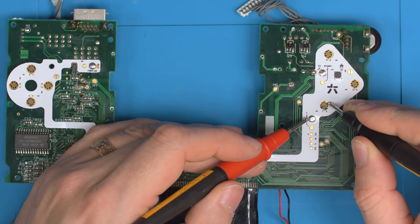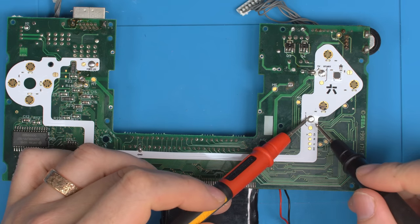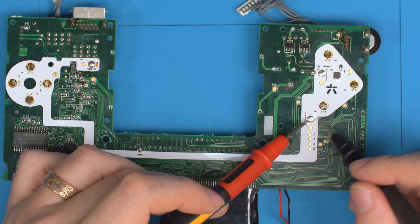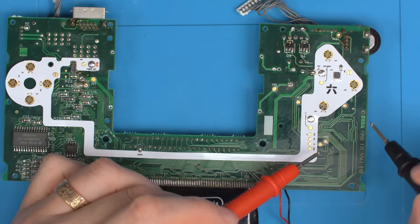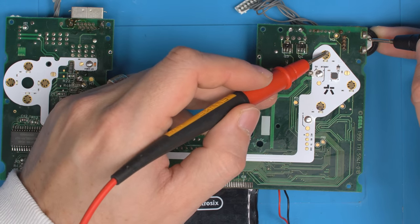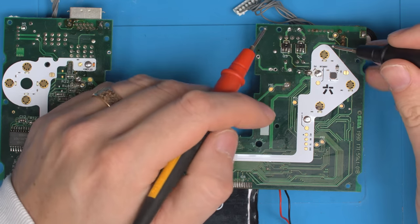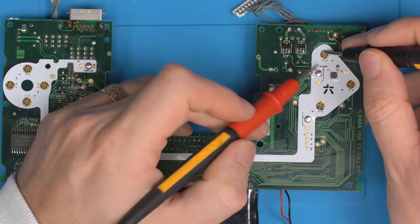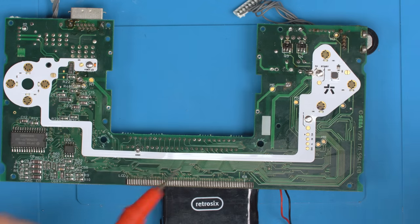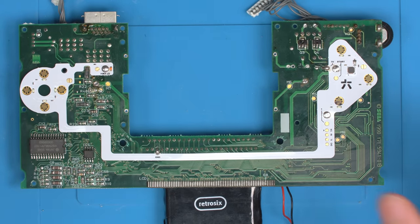So we hold on there and tap here. You can see we've got a good connection. So that's how we know the solder pad here underneath has made connection, because it's actually contacting here. A quick check on this one as well, do the same first, find which side is ground. In this case, the right side is ground, so the left side should be connected to our button, and it is. That's all the checks you really need to do, and now let's just power this up and see if